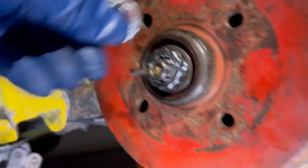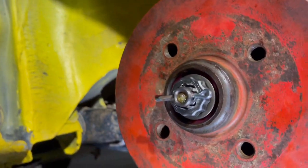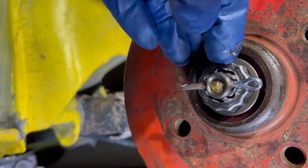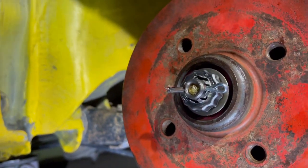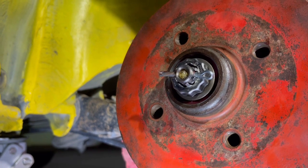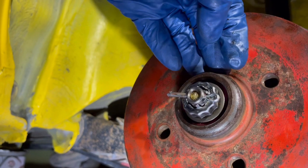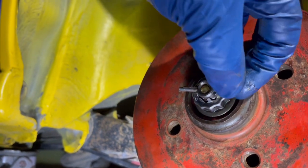So I put the new crown cap on — this is the new one that came with the kit — and no matter where I positioned it, the grooves for the cotter pin were not lined up on either side. Put the original Volkswagen one on and it fits perfect. That's exactly why I started this channel — I was tired of poor quality parts. Whenever possible, use original parts if you can. The shop I started working in as a teenager told me to repack the bearings every 30,000 miles and replace them at 60.